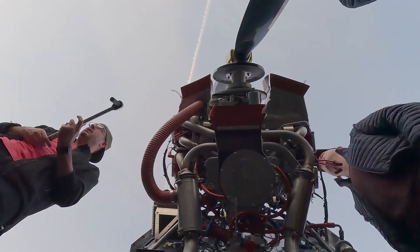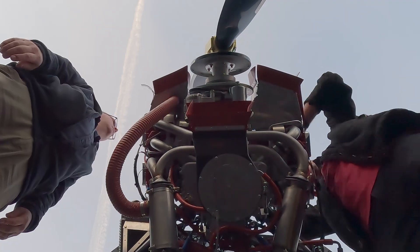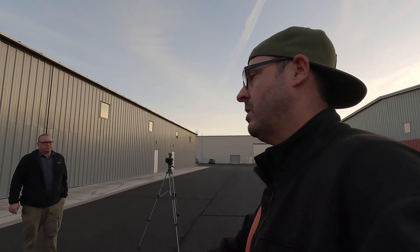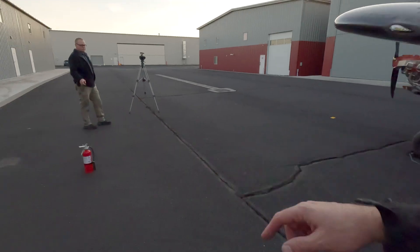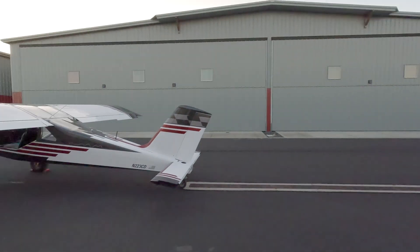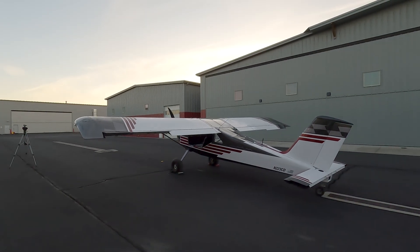Spark plug, 20 foot pounds. Use anti-seize. Limitations: I'm not going to exceed 400 CHT. Anybody can call knock it off — wave your hands, that'll get my attention. And if you say cut it, I'll cut it multiple ways: idle cutoff, ignition off, fuel cutoff valve to close. Fire extinguisher. I'm going to move the Bonanza in so I'm not going to blast it with the amazing amount of thrust that the bogey is going to produce.